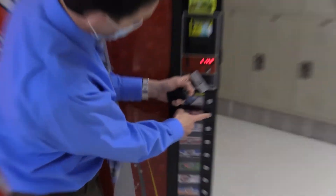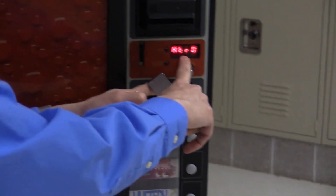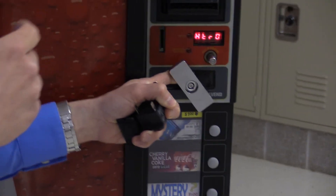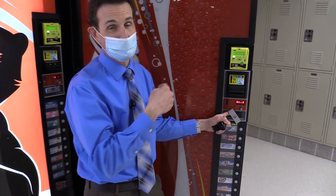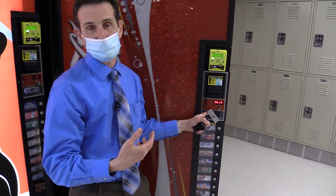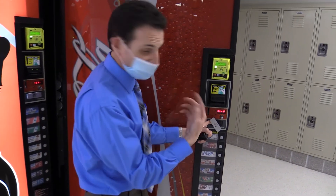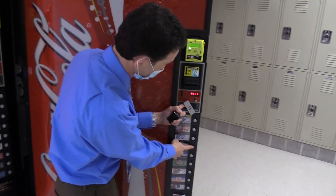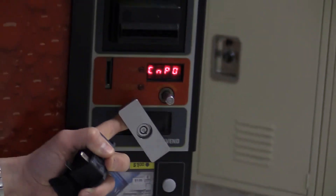The other options in here — if I go up, this is the heater relay. Some machines have a heater in them, like a soda machine that's outside in winter months when it gets really cold and you don't want the cans freezing inside. So instead of cooling the inside, it has a heater unit which warms the machine. This particular G3 does not have a heater in it, so this relay is not going to do anything. And then if I go up, it goes right back to the compressor.